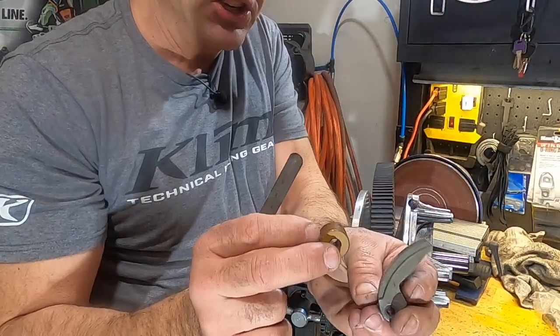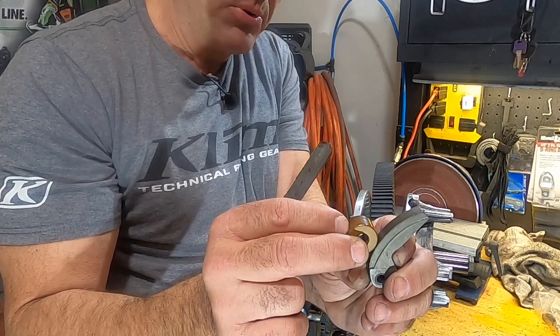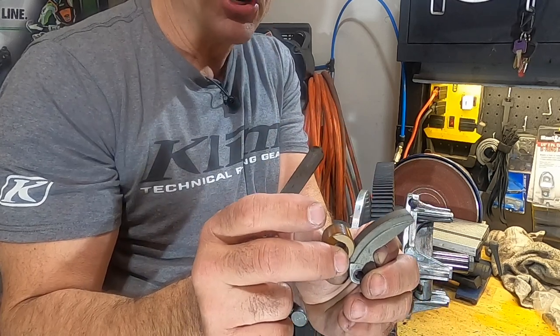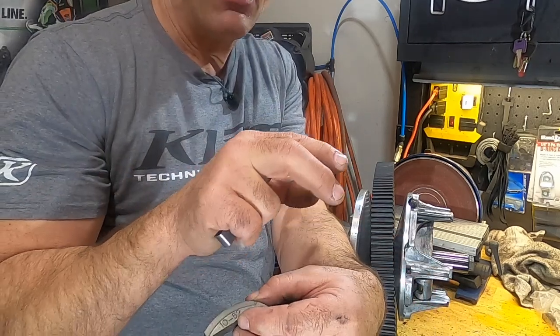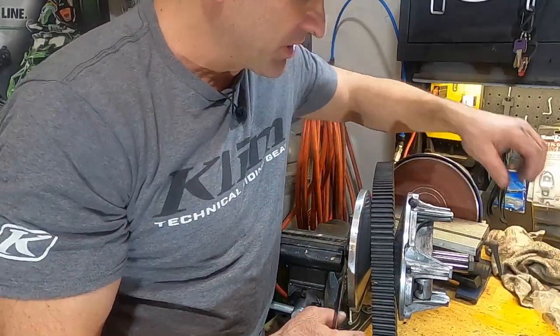We talked about this relationship between your weight and your roller. If your primary clutch, your movable sheave, has to move before it engages the belt, it puts your weight and roller in a different relationship that's not right for starting in the low gear you're starting in. And that's going to mess up how your clutches perform. It's going to mess up how the power from your engine is transferred through your clutches, through your drive system, through your track, and it's not going to work as efficiently.